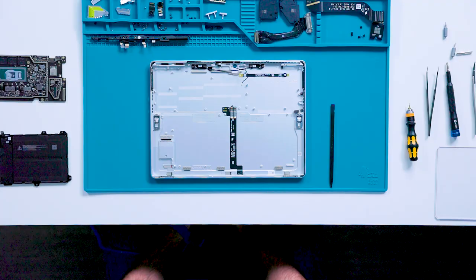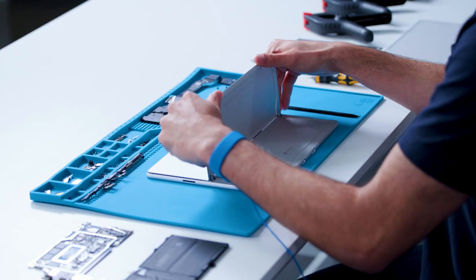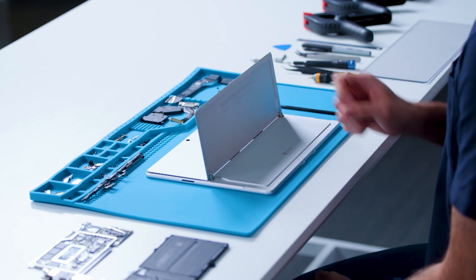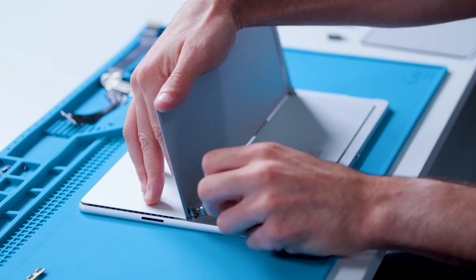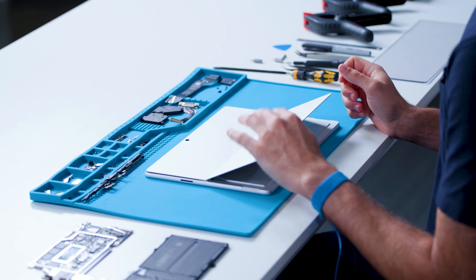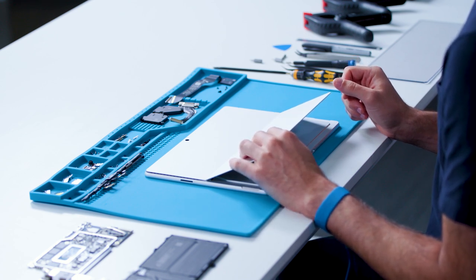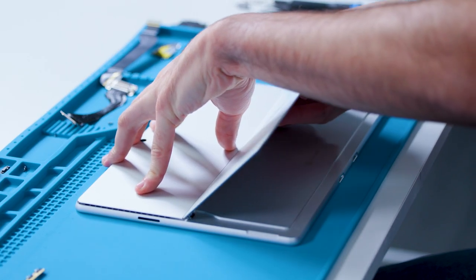Lastly, we'll remove the kickstand. Note that this component can be removed without removing the display or any of the other components, but for purposes of the video, we've rearranged the order to showcase other repairs first, since it helps to have the kickstand during the display removal. We'll first place the kickstand to a 90 degree angle to expose the screws. Use one finger to support the kickstand and remove the two screws with a 3IP driver. Next, firmly grip the hinge and the kickstand and adjust the angle to approximately 45 degrees. Gripping the kickstand with one hand and the top of the device with the other, slightly rotate the kickstand to release it from the screw bosses on the enclosure. Then firmly hold the device and pull the kickstand away from the enclosure.